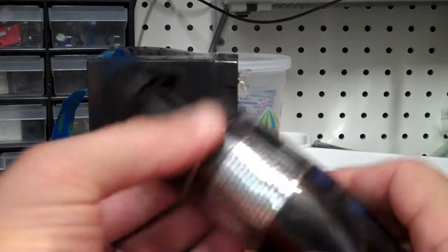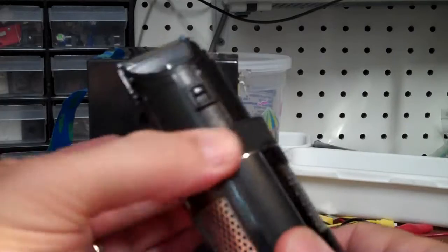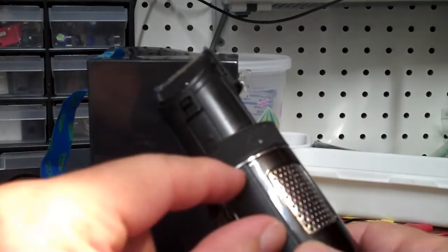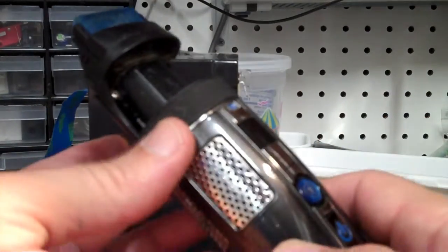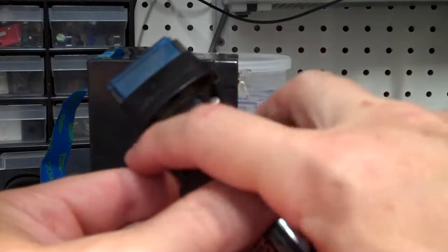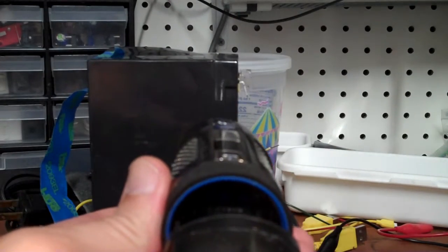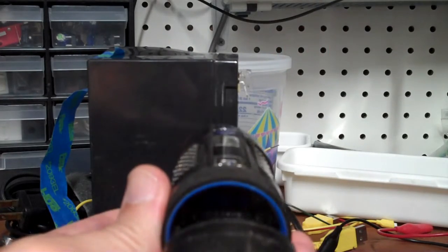So this ring, which adjusts the height, moves this little slider up and down. It also holds on this metal ring, which holds the 4 plastic pieces around the handle. To get this off, it's held on by some little pegs here that are part of this motor mount. And the motor mount has 2 screws up at the top, which are easy to get to with a screwdriver. And that has 2 screws that are down in here, and you can get to them if you have an appropriately angled screwdriver. So if you angle your screwdriver like that, you can take those screws out.